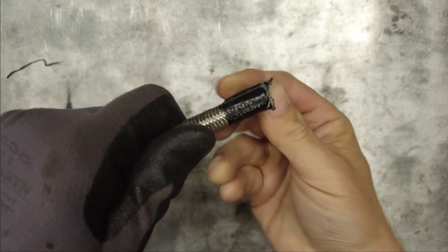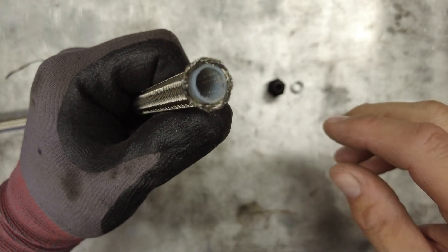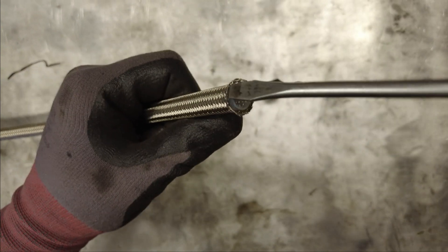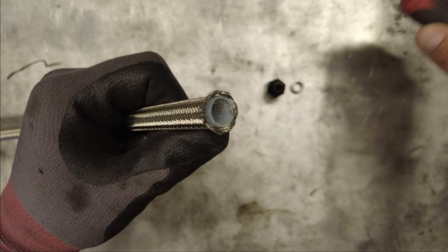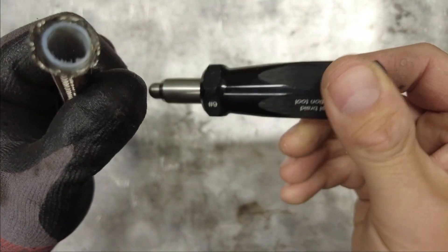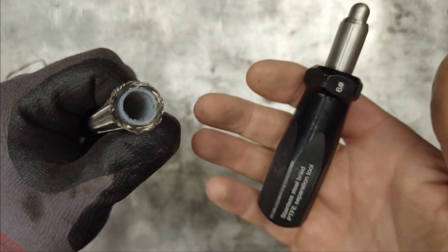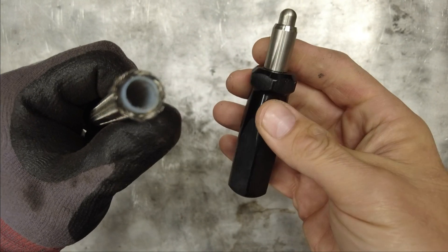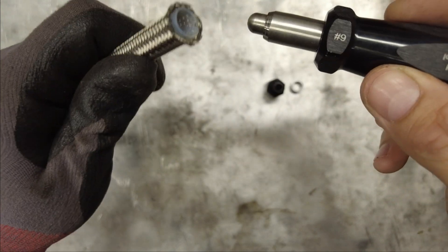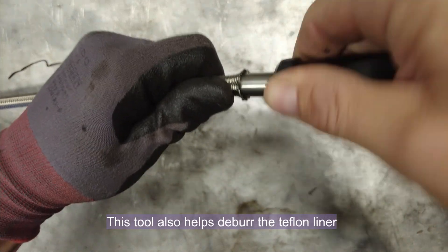In this case it's flared out a little on the end. A lot of people recommend using a screwdriver, jamming it down between the braid to flare it out - it works but can make the ends go frayed and messy. I made one of these flaring tools, which was £26 - not cheap, but I've put a link below if you want one. I like to have the right tools. Basically it goes on there all the way in and flares out the sheath nicely.